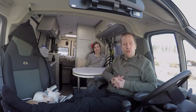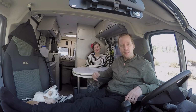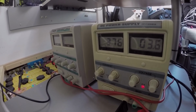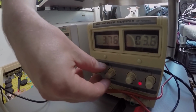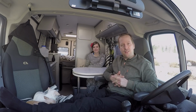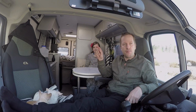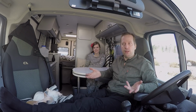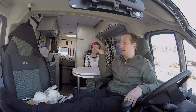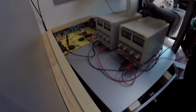Yeah, first thing was installing the batteries there, the room, and after that it was a boring part. It took us 1 week, 30 hours or more per battery, so we could actually charge them up. It's like when you had these old phones back in the days, when you had to charge them overnight, so you can actually get all the capacity of the battery. It's the same thing for lithium batteries. You always have to top balance them, or bottom balance, but we did top balance. So basically you just charge them full and then start using them.